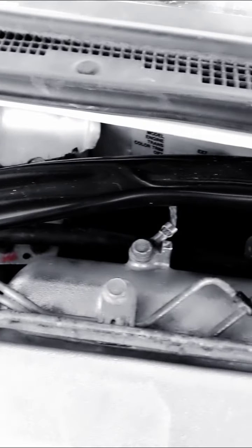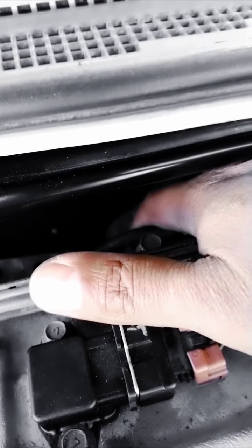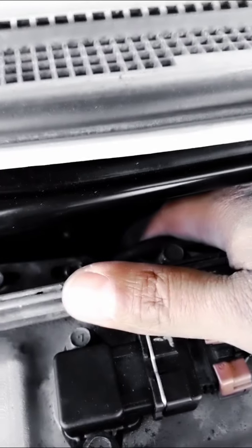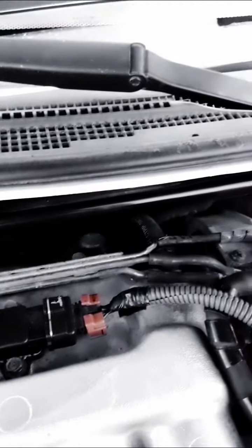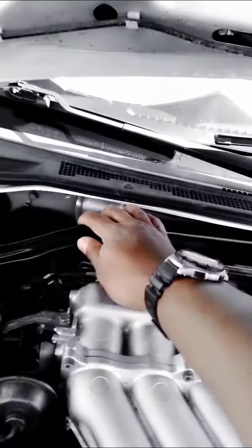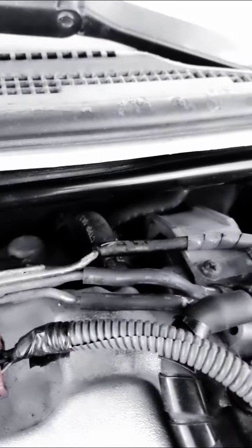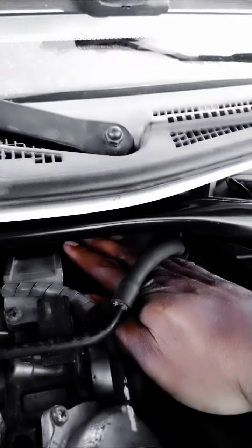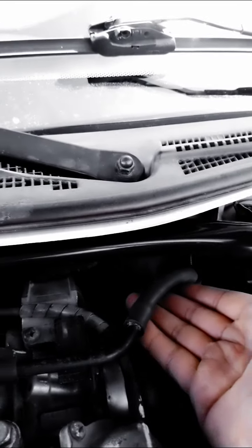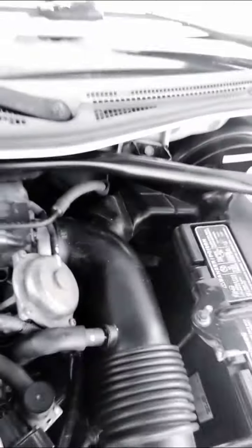The first thing I did was take off the EGR valve. It's just two bolts - both 12 millimeter. It's kind of difficult to get to back there, so I took this support beam off first to get access. If your hand or arm is too big you may need to take this off just to get your hand in there.